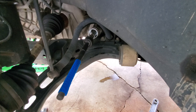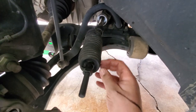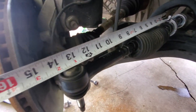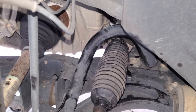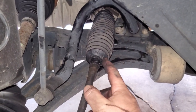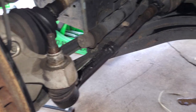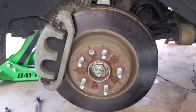I got it just snugged up — about to put the tool back on and tighten it down. I'm going to throw that boot on while I've got a little bit of room to work with. Here's where you want to remember your order of parts: boot first, then the little retainer clip, lock and nut, then tie rod. Got our new tie rod on, got the measurement back — we are good, nice. Got our boot back on using the new retainer clip since the old one was fighting me. So far the hardest part of this job is getting that boot put back on. We got our nut good and tight — we'll do a visual on everything, make sure it's all in place. Looks good. Now we just throw the wheel on and we're done.